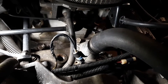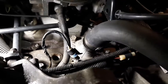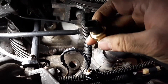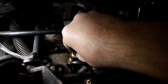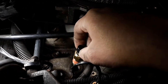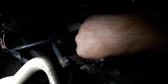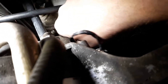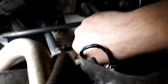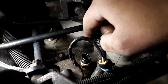There's no coolant in the system so that's why there's no fluid coming out. I'm going to clean this surface a little bit with a rag and then throw the new one in. Here's the new one — go ahead and start it in by hand. It has this red Teflon-type tape that seals the sensor to keep it from leaking. If you got a cheaper one with only a one-year warranty, it more than likely won't have that — you'll have to put some Teflon tape on it before you put the sensor in or it might just leak.